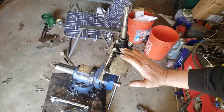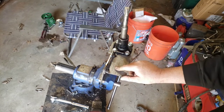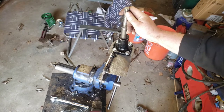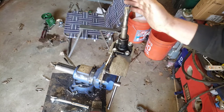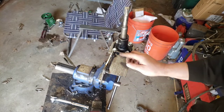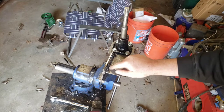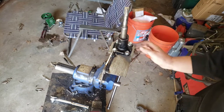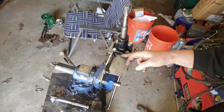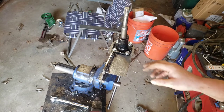Here is the bracket that I made up. This goes in place of where the power steering gearbox used to be, and this just so happens to be the same spline as a Toyota 36-spline, 17mm or 11/16. However, this is significantly longer, so I'm going to go ahead and weld these in — I've got them tacked right now. I'll go ahead and weld these in, and then I'm going to end up having to cut a pretty significant amount of this away. Unfortunately, most of the strength is right here, and you can't brace it.